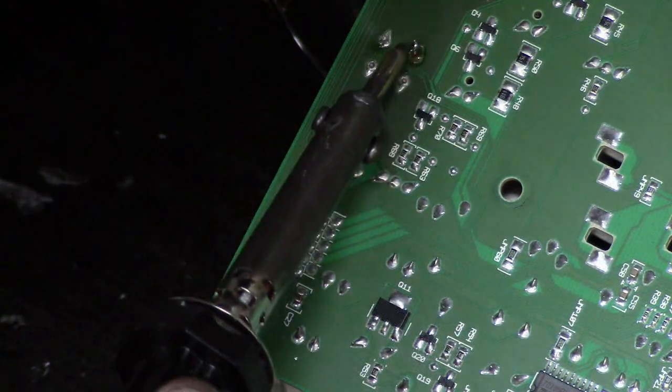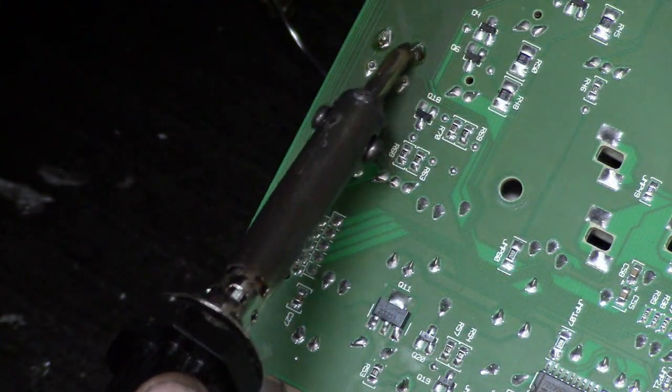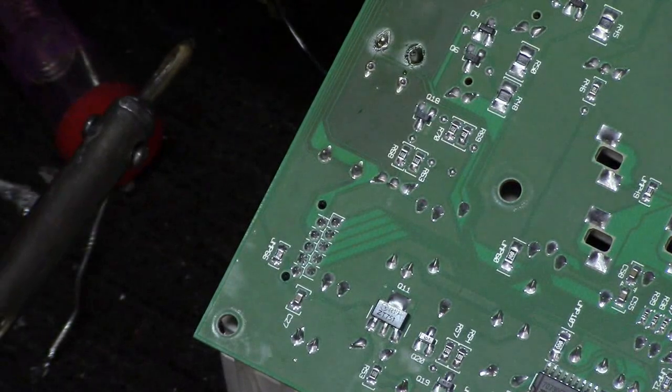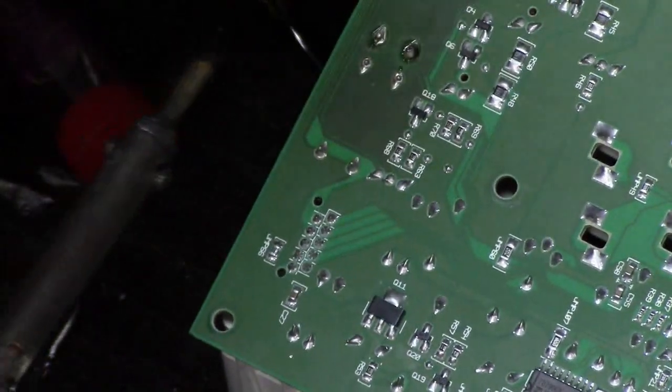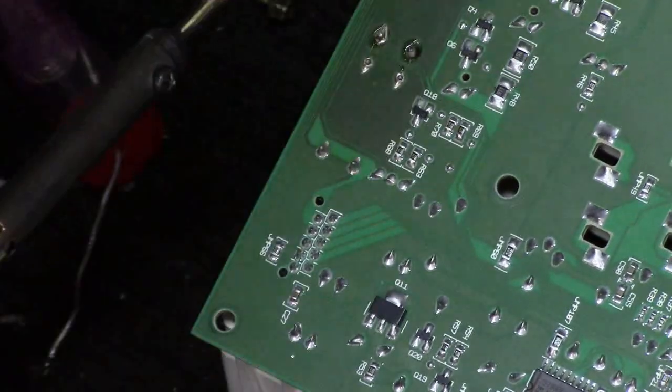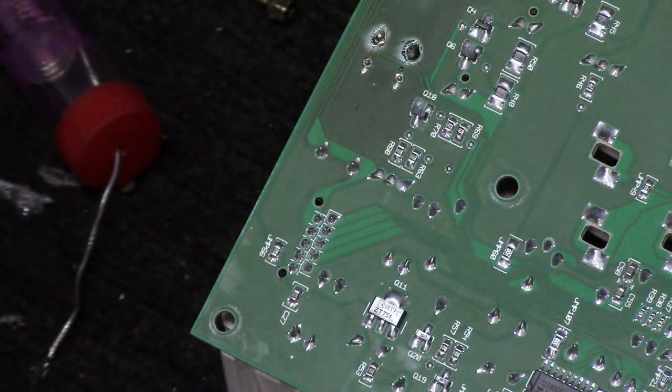Do this one next to it here — this one's a little easier because the pin's taller. This method does take a while because you've got to heat up the pin first. It doesn't melt the solder as quickly as if you just touch it to the iron, but I believe this kind of draws the solder in a little better. That's a good one — kind of clean it up a little. Let it cool for a second, wiggle the pin — it no longer wiggles. That is a stable connection.